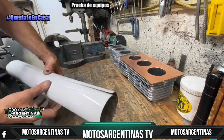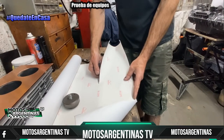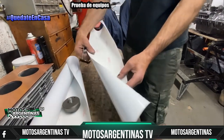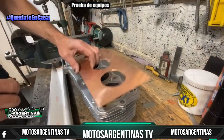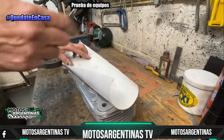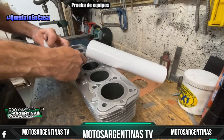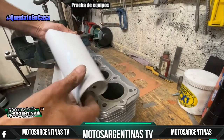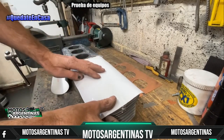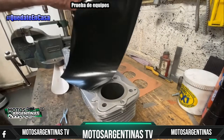An easy way to mark out a gasket is to use sticky back plastic, or you can buy it in a roll really cheaply on eBay. First, cut out a piece of sticky back plastic roughly to the size that you want to use. So in this case I just cut it in half and it was perfect, one for each side. Just checking it fits. Then peel off the backing and stick it onto the cylinder block, pressing down firmly.